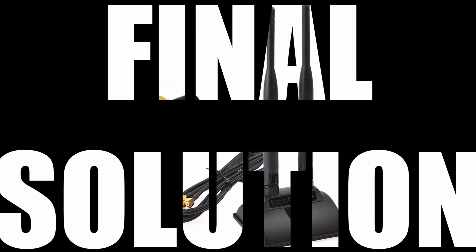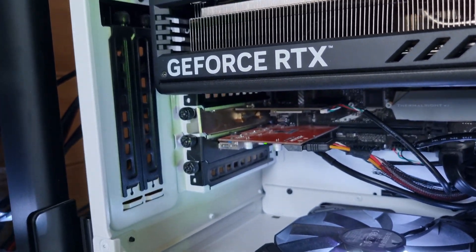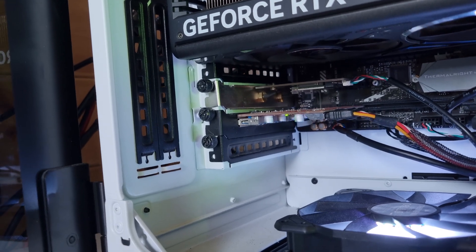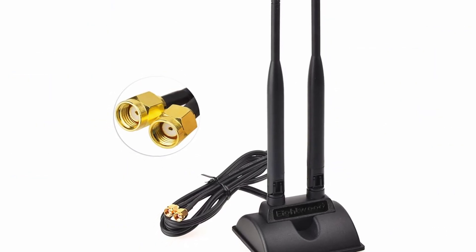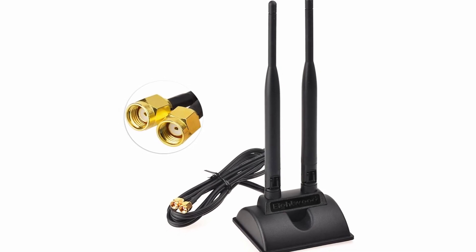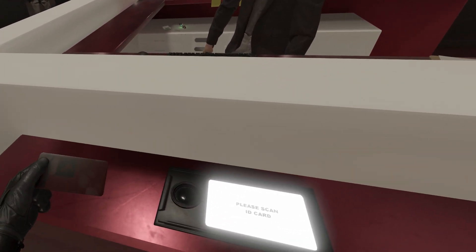My final solution: I removed the USB dongle and reinstalled my Bluetooth PCIe card, updated to the latest drivers, then bought an 8Ware external Wi-Fi aerial extender from Amazon. It basically replaces your card's aerials with a two-metre extender you can place closer to your play space. As soon as I installed this, everything snapped into place — my tracking is now flawless, and I'm a very relieved little VR bunny.